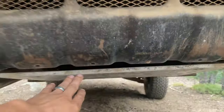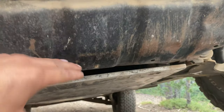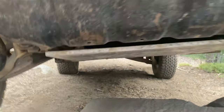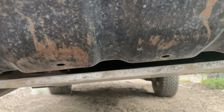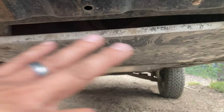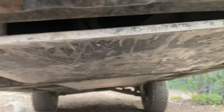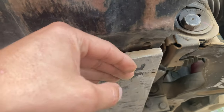Right here you can see there's a good lip and I don't love this — I'm about to make a kick-up so it transitions more smoothly over rocks. I've hit this point blank and it stops the vehicle really abruptly. This is a half-inch thick piece of T6061 aluminum, so it's a very hefty skid plate. It mounts up to the factory spots. I hard-mounted it flat since flat skid plates are easy — you just cut it out. I did some fancy work with a mill and recessed the bolts so they don't shear off or get hung up on rocks as I go across.